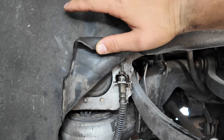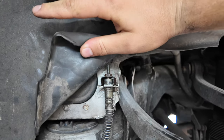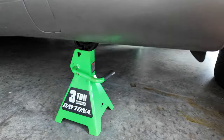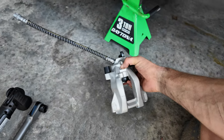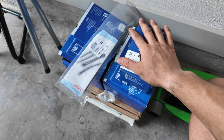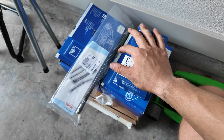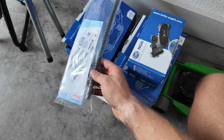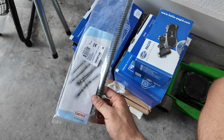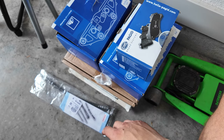For anyone attempting this at home, I sprayed it down with some WD-40 to loosen it up, but it looks like it's a bracket, so we're literally just going to unscrew the old hose and remove the caliper at the same time. Sometimes with these old cars — considering it's a 21-year-old car — the inner tubing of the brake hose can fail, which pretty much traps brake fluid inside the caliper. These were only about 15 bucks, so it makes sense to replace them anyway. I got all these parts from FCP Euro, except the rotors, which were from Rock Auto. I'll put links in the description below.